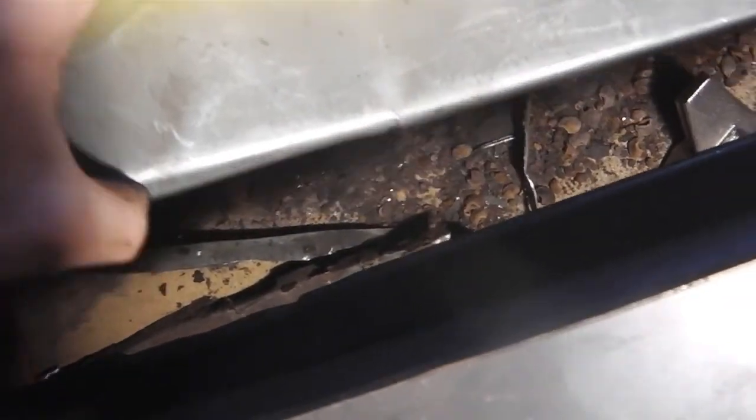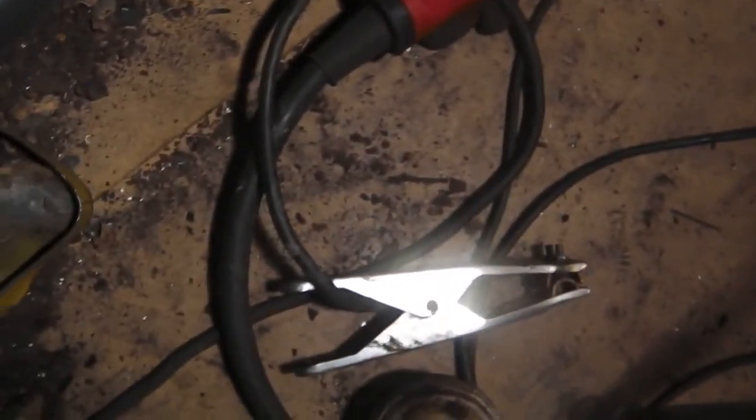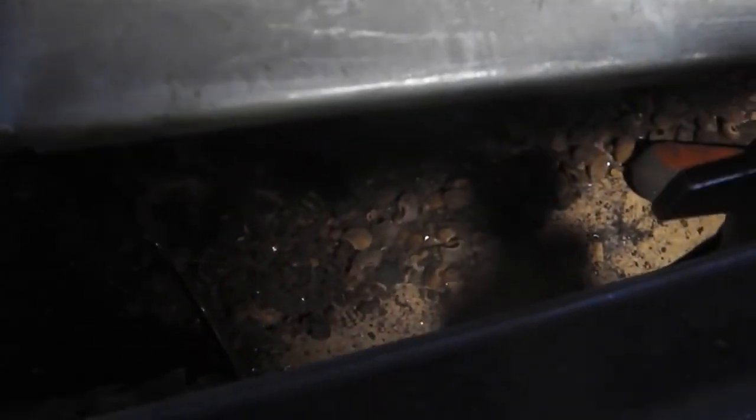Okay, so we've taken that off, as you saw with the air saw. We've popped this panel in now. Watch this. Now we get these very handy clamps. Put that on the new leading edge we've done. Offer it up to the sill. See that coming in there? Then we're going to drop this. Hang on, I'll just move the camera.